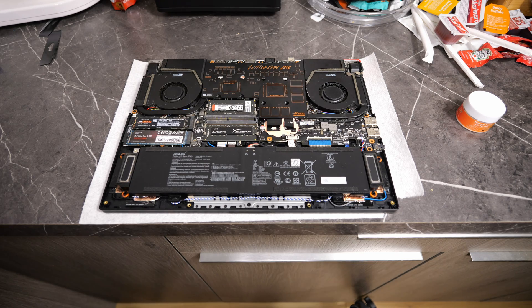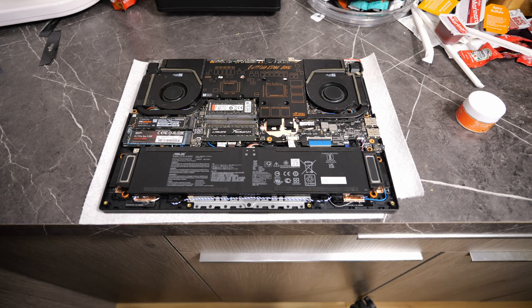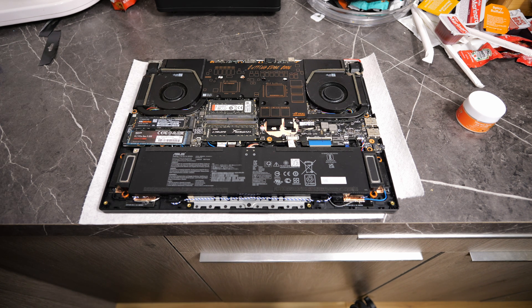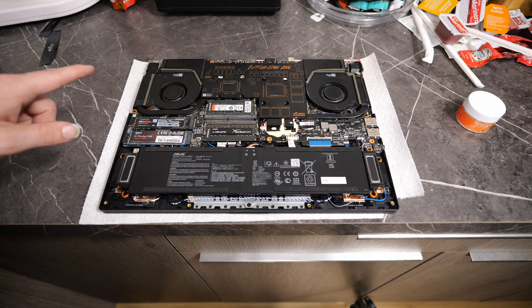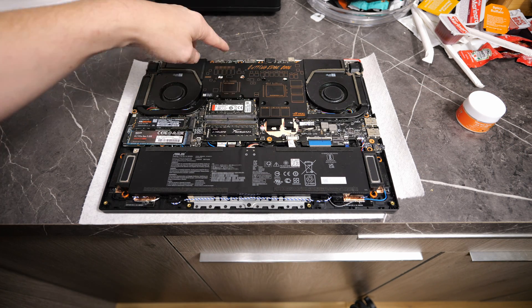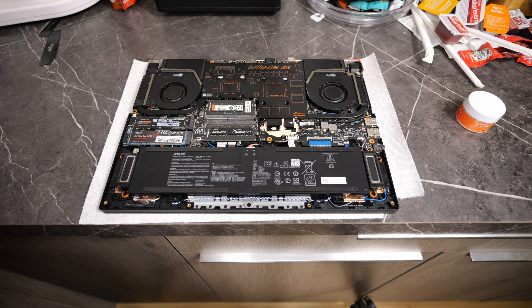As you can see, I cleaned the fans finally — top and bottom, really good. The rest of the laptop looks fine besides the goop from the old compound. I went a little overboard on this but it wasn't popping anything up, so we should be all good as long as we're getting good contact now. If not, I might honestly just go back to thermal compound all over it and say screw thermal putty, because at least that way I had good contact. But I think I did a much better job this time.